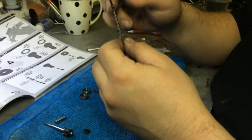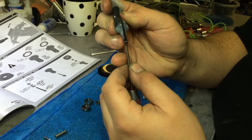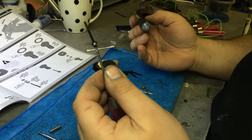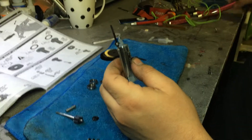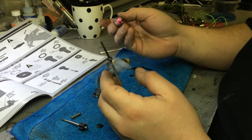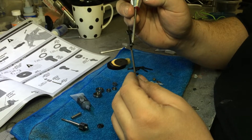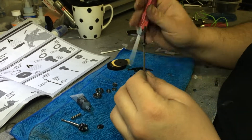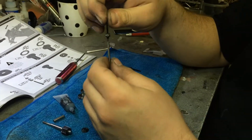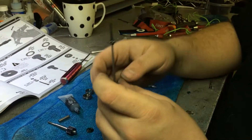Now that we've got our diff screw on and our allen key here, I make sure I find the right size. You put the one flat washer on — again wiping it off just to make sure it's nice and clean — and you're going to put a big coat of black grease on here. Now that it's on there, we're going to do the same trick with another allen key; make sure it's not magnetized again. Put a big drop on the end of that one and we'll use that to pick up the balls. I got them all on, I put the other washer on top, and I just go around with my fingers and push them all in so that when you try to put it in the output it doesn't squish any of them out.